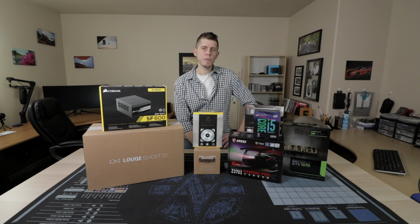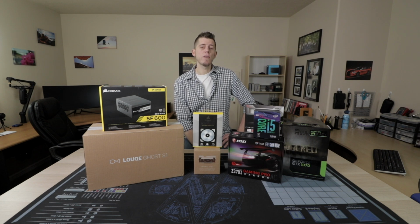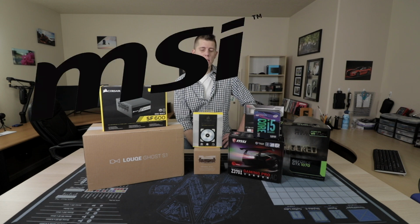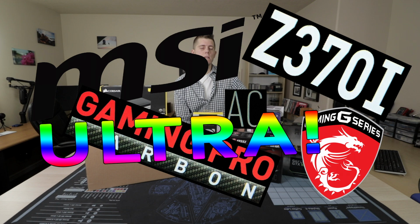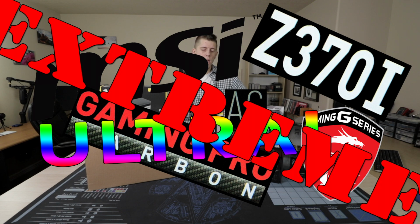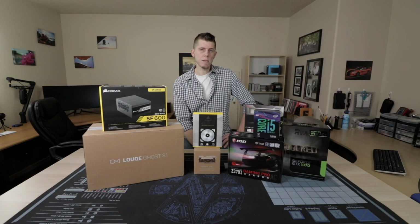And since I decided to upgrade the CPU to an 8th Gen i5, it only makes sense that I have to upgrade the motherboard, since the 8600K won't work in the Gigabyte H110 that I had originally used. For that, I decided to go with the MSI Z370i Gaming Pro Carbon AC. It's a mouthful, but it just didn't make sense to spend the extra money on the Z390 for me, and this board had the features that I wanted.